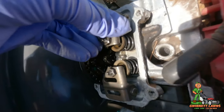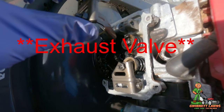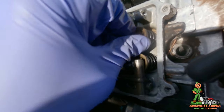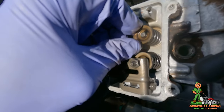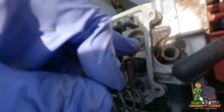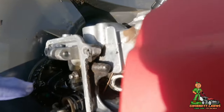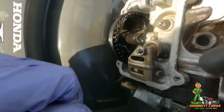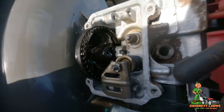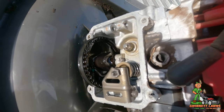I'm going to pull this intake valve rocker arm off. This is the one I replaced last time because it broke. I'm going to push this in — I want to show you guys something: the valve stem is working its way out again. See how far this is pushed out right here? This piece is supposed to be much further in there. I'm going to take a socket and drive that back in — this is a problem with these engines.